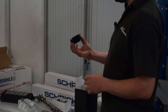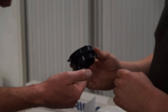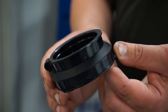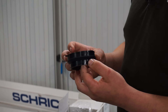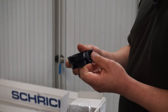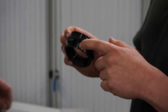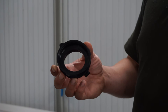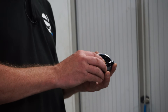And then the final party piece is NRW silicone intake couplers. These fit between the throttle body and the airbox. The standard BMW ones — a lot of people slate them and I actually quite like them, but as they get older they're definitely not the one. These have got all the features built in like the factory ones: they sit properly into the throttle bodies, the airbox fits in them properly, and they've got a little tab here that stops the clamp spinning round, which means you can take them on and off in situ. They're a really nice piece and far more durable. A lot easier to fit as well.